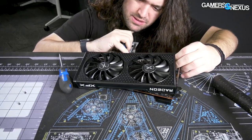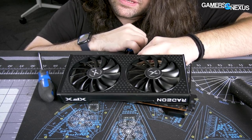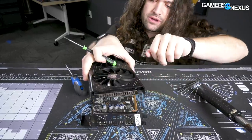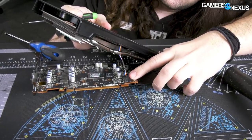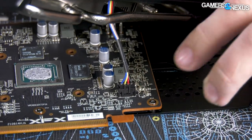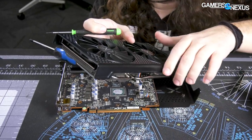I don't know why XFX always does this. They use fan connectors that have these little plastic — they're not even really clips because they don't actuate. They're just plastic appendages attached to the fan cable that make it really hard to get out. This is something you should know, and it's going to be true for most video cards. Down here where this cable is connected, it's very tempting to just pull up on the cable. A lot of times that will work fine, but if it's one of these it's kind of secured opposing the pull, so you'll end up pulling the housing off of the pins. Normally you can just reseat it back on top of the pins, no problem — sometimes you have to re-solder it if you break pins. Just don't pull on cables for video cards in general, because you might break it.